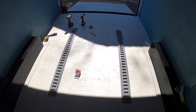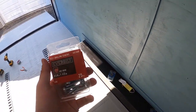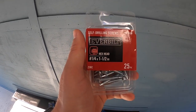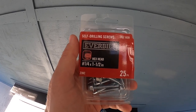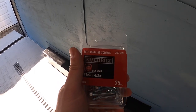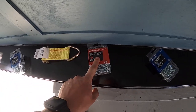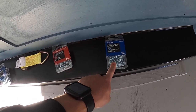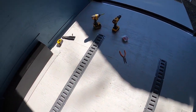I have installed the first set of E-Trax successfully. For the screws I'm using when drilling into the actual frame of the trailer, I'm using these Everbuilt hex head screws — these are self-drilling or self-tapping. You want to make sure you're using self-tapping screws if you're drilling into metal; standard wood screws won't get through the metal. Even though these can drill through wood as well, I was actually drilling pilot holes with a drill bit just to make it easier, because the screws were wobbling back and forth. Once I drilled pilot holes and gave the screw a place to go, everything went in much smoother. My recommendation: drill a pilot hole first, then drive your screws in.